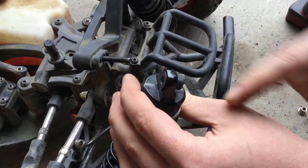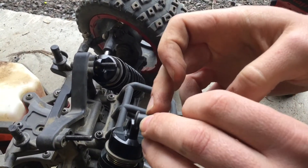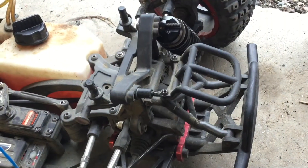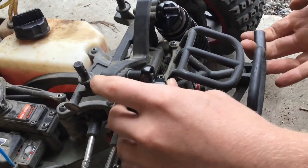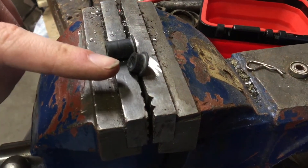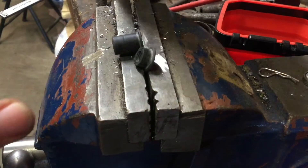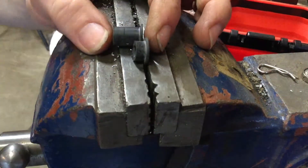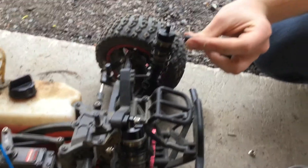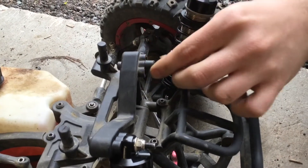They fit mint, but as you can see there's a little bit sticking out, so you're gonna take a razor blade and cut a little bit off. You're gonna take five millimeters off of the shoulder side of the well nut. Once you cut the first one, it'll be easier — you can just line them up and simply cut with the razor blade.